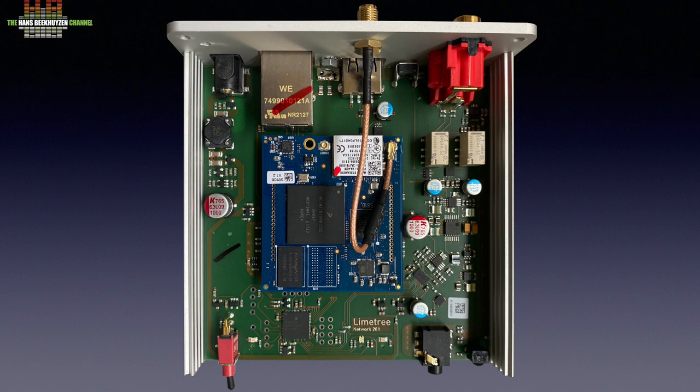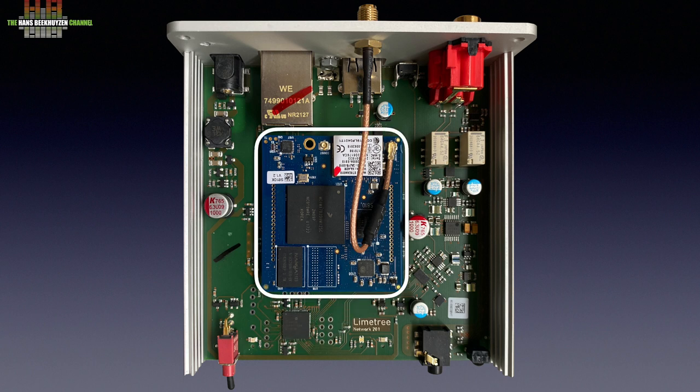Inside we see a circuit board covering the bottom, with on the left the filtering of the 5V DC power. Then a small Motorola microprocessor that controls basic operation functions. The real work is done by the Stream Unlimited Stream 810 audio streaming module, a ready-to-use streaming solution also used by the LimeTree Bridge. It is a good and solid solution that uses DLNA UPnP AV, but also accepts Roon RAAT signals and has Bluetooth BLE 4.2. It handles all network traffic and is based on a dual-core iMX7 processor. This way audio companies can focus on what they do best — audio — and leave the network task to the supplier.